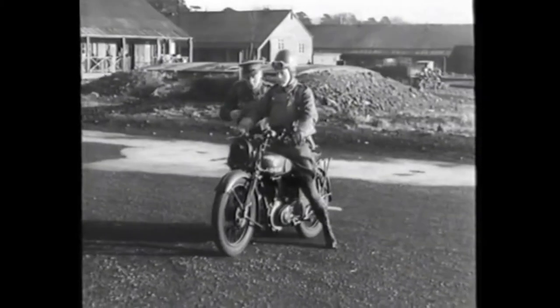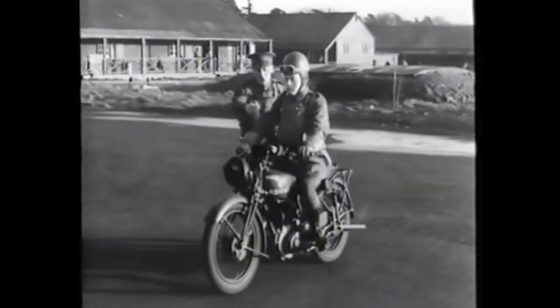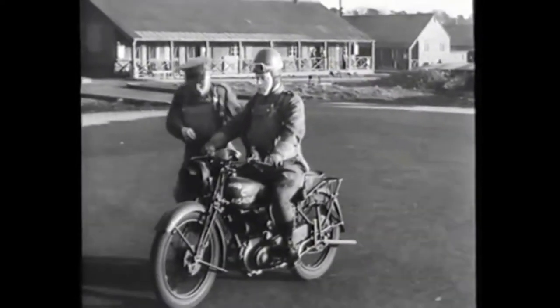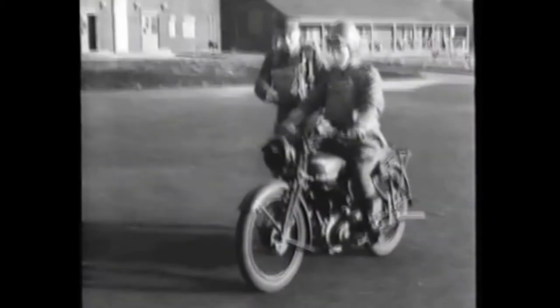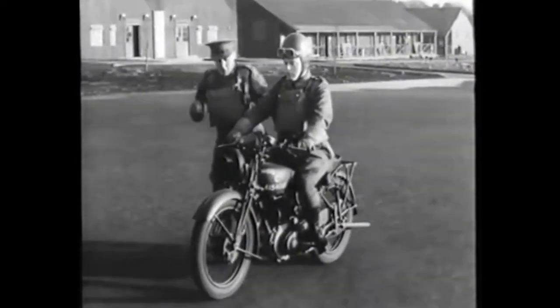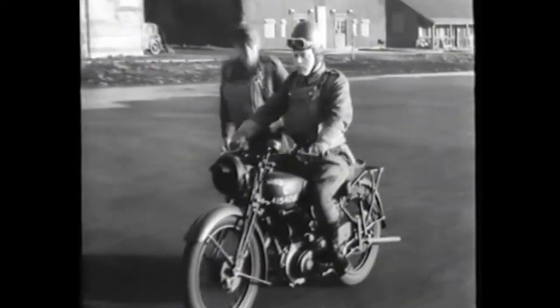is telling this rider. The feet should be placed on the footrests immediately you're underway, and as you proceed, resist any temptation to put your feet to the ground. Your throttle now controls your speed. Treat it with respect, open it gently and close it gently, and always avoid the flashy use of the throttle so dear to the young, sporty boy with his first motorcycle.